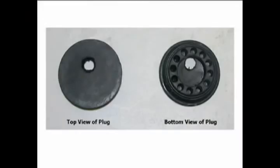These are the 2 rubber plugs that have been removed from the front corners of the bed earlier. They have been drilled with a 1/2-inch drill bit on the loose side to allow the drain tube to fit through them. Notice also that they have been drilled slightly off-center. The tubes will be slid through those and cut down to length. Now you'll be sliding the drain tube through the hole that you drilled in the rubber plug. Cut the length of the tube to fit properly and push the rubber plug back into place.